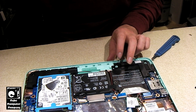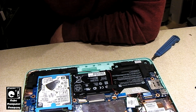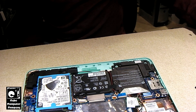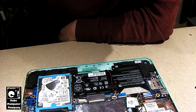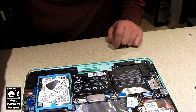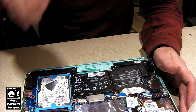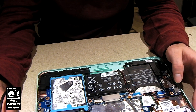Interesting — this machine's battery is literally just two cells, a two-cell pack, so 7.6 volt, instead of the 10.8 or 11.1 volt you get with three cells in series. The 7.6 volts tells me it's probably a 4.35 volt cell — two LiPo cells. Anyway, with the battery disconnected, let's try to power this up. Same deal — the power indicator literally blinks, and that's all. Very odd. Could be a motherboard failure. Even with the battery disconnected, it just blinks. Does not power on.